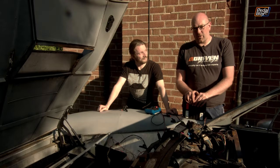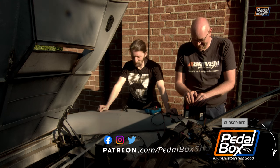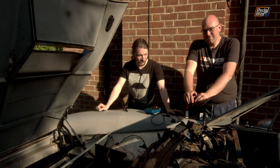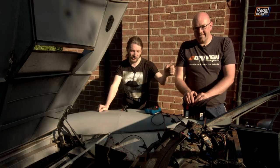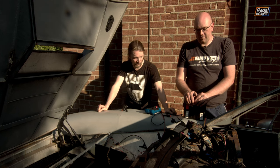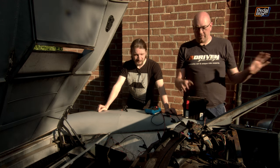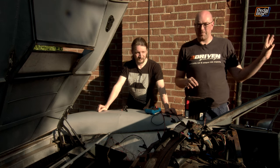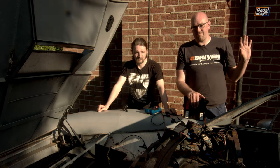Now when people ask 'have you started it?' we can say no, but we are closer than ever before. A lot of the work today and last night is a long way from getting the engine running or getting a new ECU in, but it does mean we've got the confidence to shove an expensive new ECU on the engine and plug the thing in without being particularly fearful of it blowing up. We've tested a lot — if there are any shorts we haven't found them yet, so that's kind of a win. Hopefully there are none in the engine-side loom; the majority of this is the car-side loom so we just have to hope that's fine.